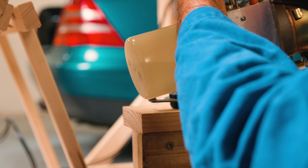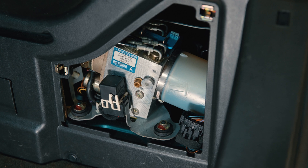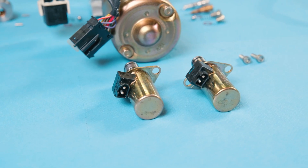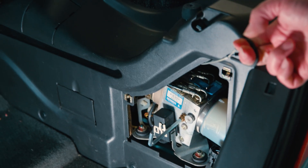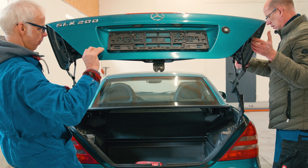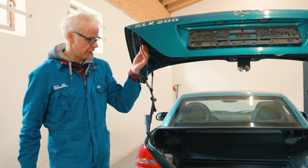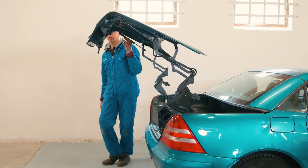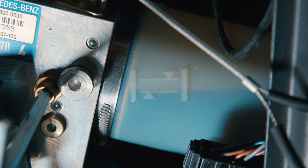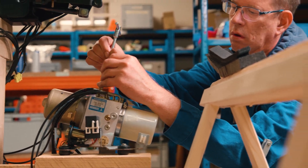This video has already shown the small size of the pump pistons. With a delivery volume of 0.3 liters per minute, circulation and bleeding are still quickly taken care of. Officially, this is the position where the oil level should be measured. Regarding the markings, an oil level between min and max is always okay. With cold oil and in the shown trunk position, being close to the min mark is not a concern. It also makes sense to observe the colour of the fresh oil.